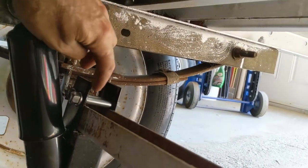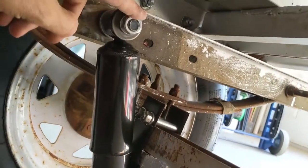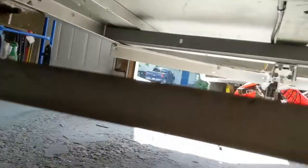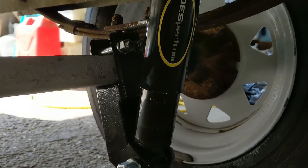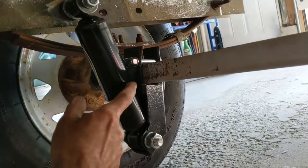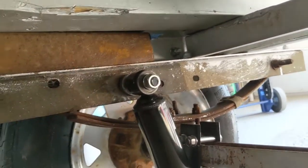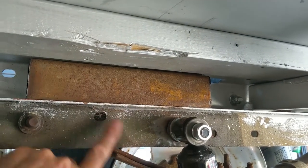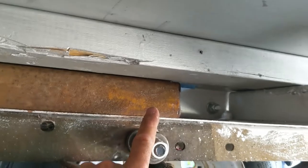To recap the install: I drilled two holes in the bracket I made — seven sixteenths bolts, five eighths bolt for the lower shock, half inch at the top, lock washers on them. That's the install for the shock on the Harbor Freight trailer — they're also sold through Canadian Tire, they're the same thing. I think this one here just doesn't have enough travel, so I'll be making a bracket out of this two-inch stock. It fits right in there in that boxed section of the frame. I could drill through and bolt it up the same way the current piece is clamped on.